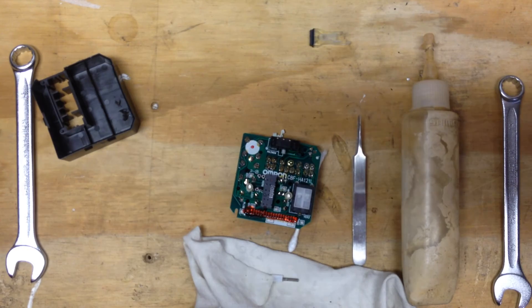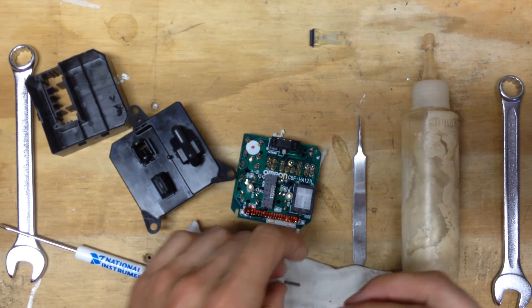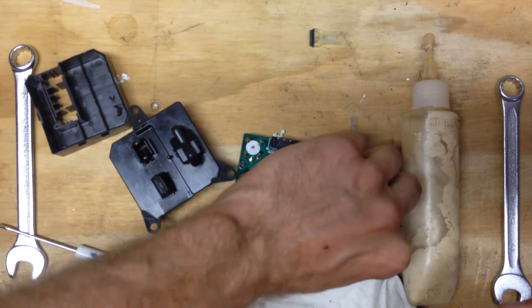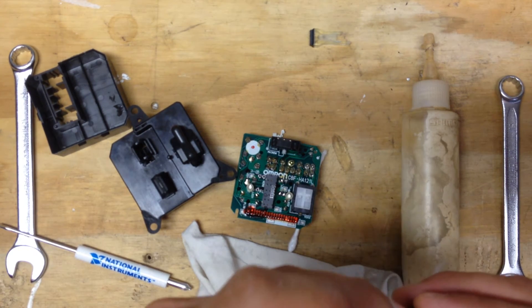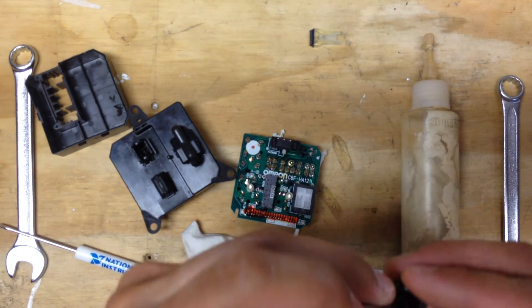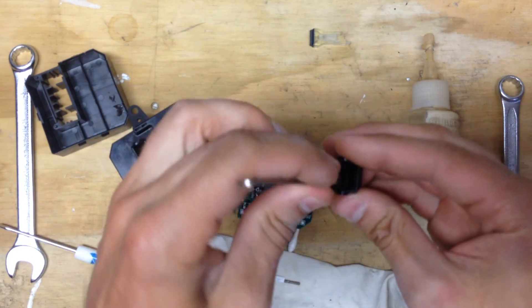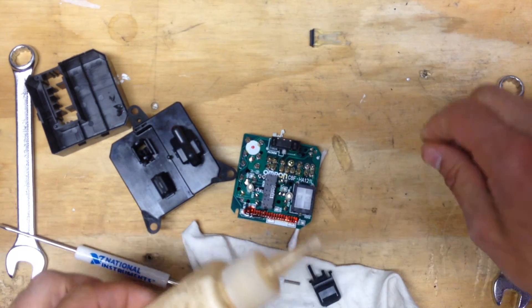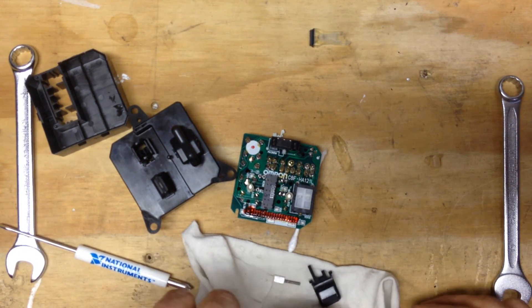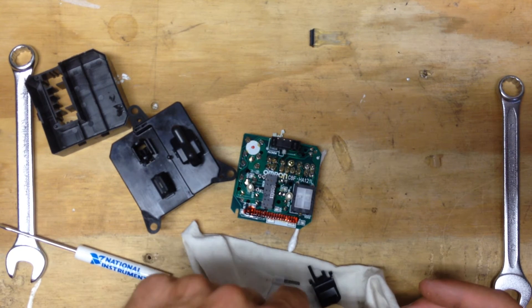So I'm just taking this back off — it's easier to do out of frame. We're going to take our new spring here and clean out any debris that might be in here. I should have done that before. And we're going to take some grease here — I'm using Shimano bike grease, but you can use whatever you want. Just don't use oil. Oil will get all over the place.